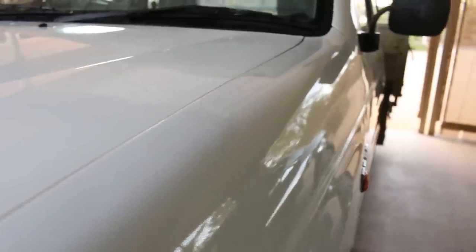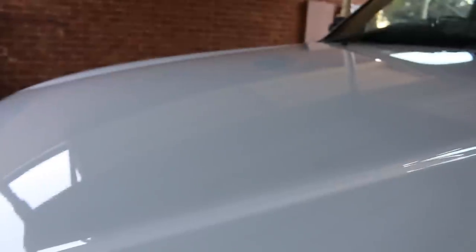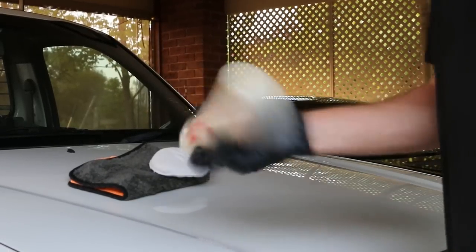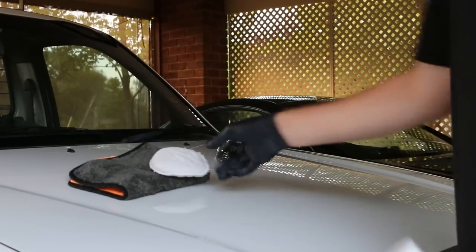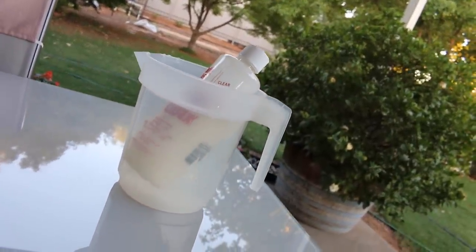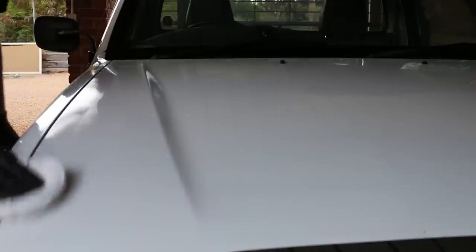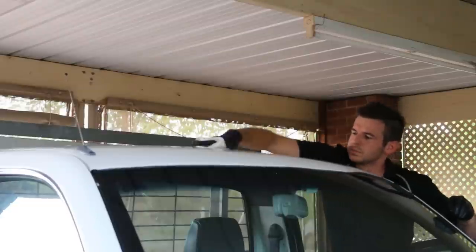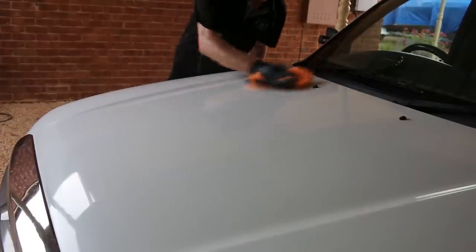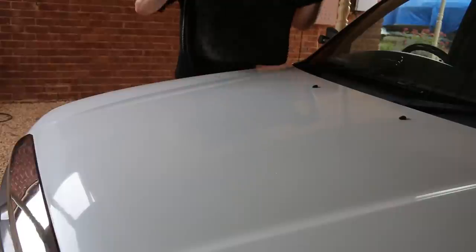The polishing was now complete, and all up this job has taken me around 6 hours so far. All that needs to be done now is to protect that very clean paintwork. I'm using Collinite 845 — if you want a more thorough video about it, I've made one already and the link will be in the description. It was easier to apply after resting in hot water. I spread an even coating over every surface before wiping it down after around 5 minutes — the low pile side to remove the majority, then the plush side to buff to a nice slick finish.